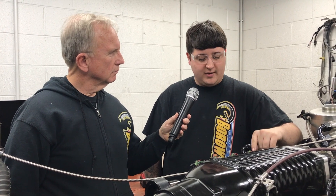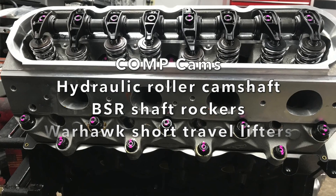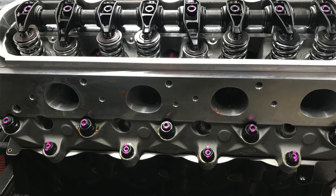The major differences are that anything above a thousand horsepower is now getting fitted with an All-Pro cylinder head, along with the Comp shaft-mount rockers, and they are now topped with the Fast XR series coils.